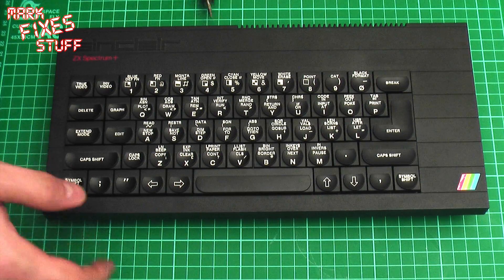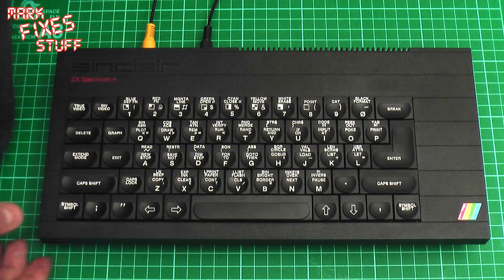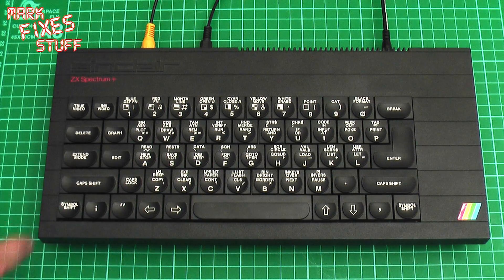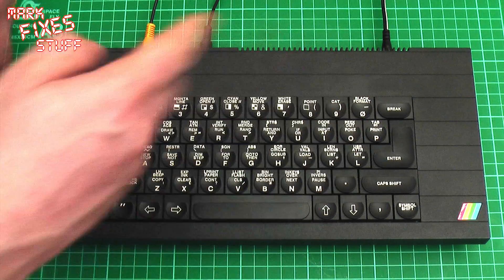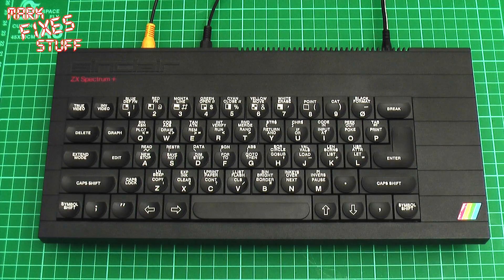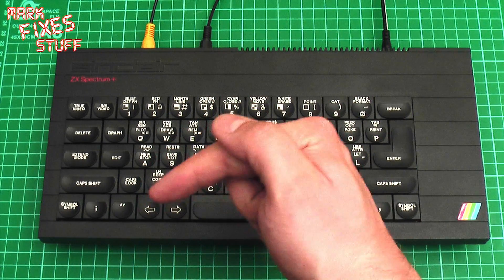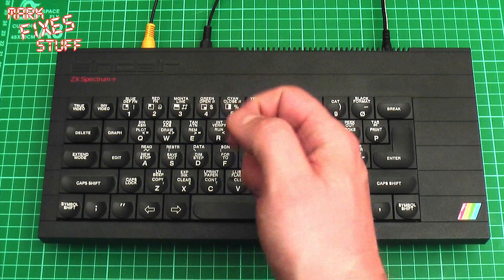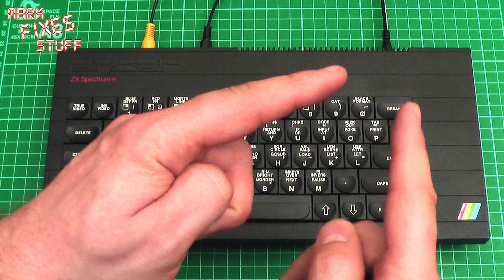Does it work? Let's try it. Mono cable into the ear socket and my adapted cable into the RF output socket, and the all-important barrel plug for the power connector into the 9V DC socket - and click, it's working! Brilliant. Time for speccy goodness. It's a good idea to actually check all of the keys and also check whether it's a 48K or 16K Spectrum or if it has any memory faults. Down here is where you can find sellmyretro.com which is good for spares, membranes and all sorts of Sinclair goodies - highly recommended. Up here is where you can find my video showing you how to load software super speedy into real Spectrum hardware using your computer sound card, and over here is where you can subscribe to get your fix. Subscribe!